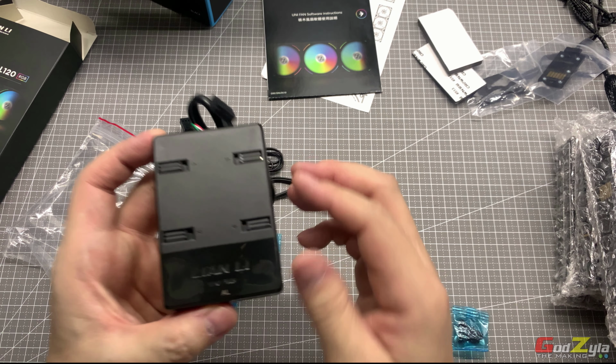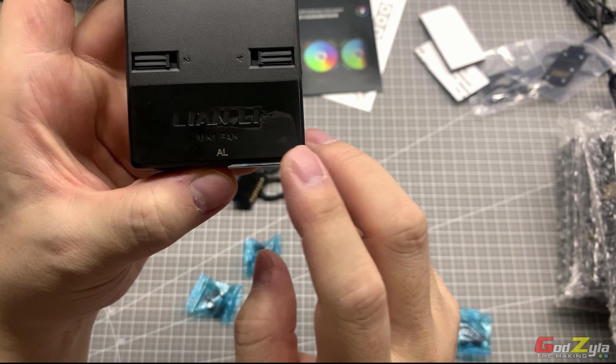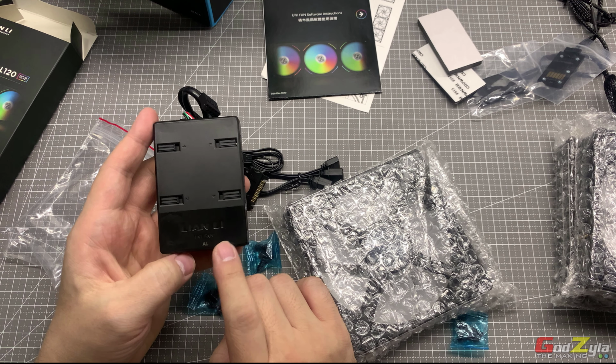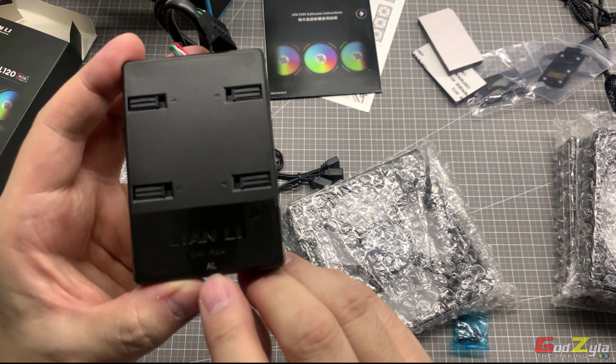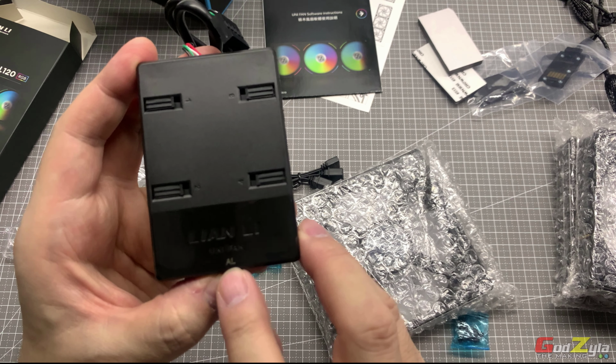Now, I noticed that on the control unit itself, there is this AL controller. I believe that Lian Li doesn't want you to confuse using these fans on the SL controller. And I believe it's of a different firmware as compared to the SL. That's why they indicate AL here. Now, the very first version of the SL120 doesn't state SL or AL. It's only later that they indicated that the control unit is either SL or AL, which you can see over here. This is the SL, and this is the AL. Having said this, maybe in the next video I'll dismantle this and check the amperage and let you guys know.